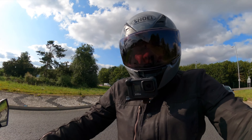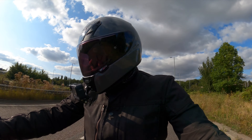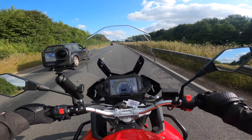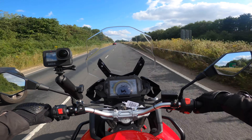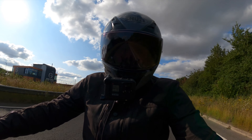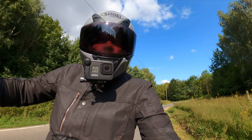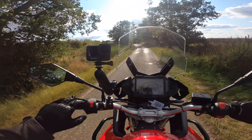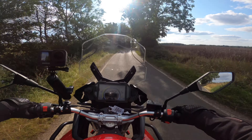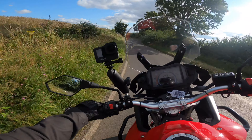There's a weird bit of gearing — in third gear you're at 47 miles an hour, and the jump into fourth gear doesn't really seem to make much difference; it feels like it's the same gear. The gearbox has got a pretty decent action, it's quite slick. You do have to work the gearbox quite a lot obviously with that limited amount of power and low torque, but generally it's not too bad.